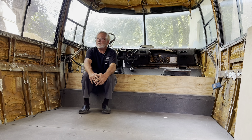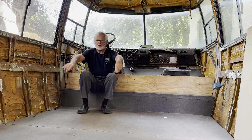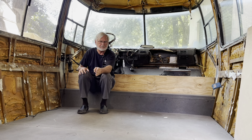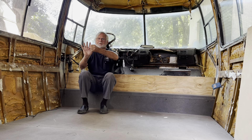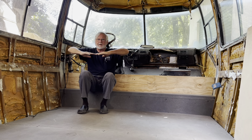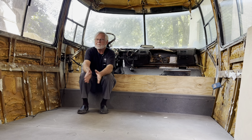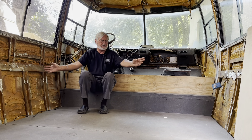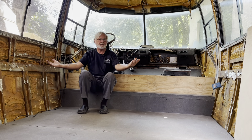If you go in your coach and put a 2x4 from the door all the way to the wall and it's not flat — in other words it goes like this, with the top high — that means the body has dropped. Another way to tell: if you open your bathroom door and it hits the closet on the other side before it fully opens, the body's dropped and the floor is curved. If your floor is not rotten and damaged, you could probably save your investment by putting in the gusset set and getting the weight back out on the body rails, as opposed to 14 inches inboard — that should straighten up your body.